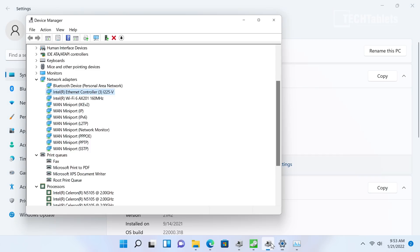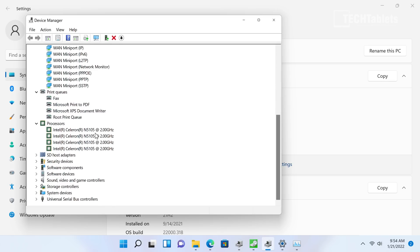Connectivity is really good here. We have Wi-Fi 6 AX201 — a lot of other Jasper Lake devices I've reviewed only have Wi-Fi 5, the typical Intel 3165. This chip supports 1.3 Gigabit transfers with my Wi-Fi 6 router. We also have an Intel Ethernet controller, not the typical Realtek we normally get, which is another positive.